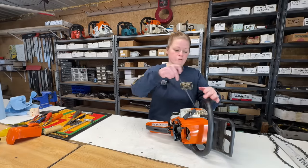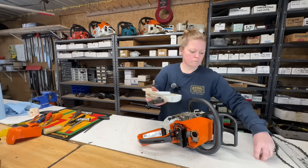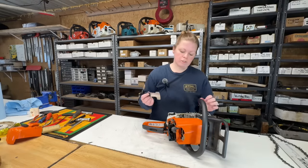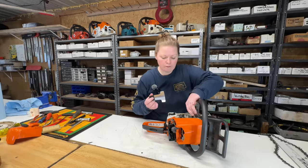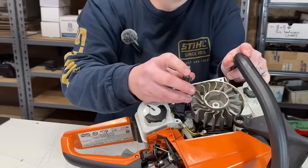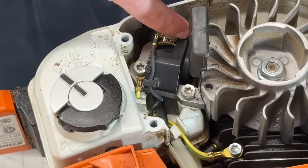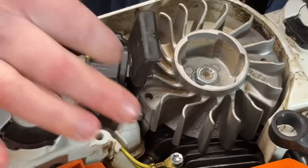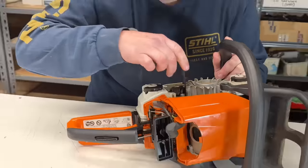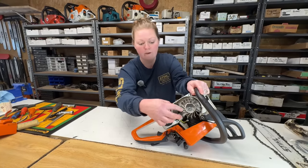T27 — I'll start removing this recoil. I'm going to grab my gap tool and check the gap between my flywheel and my coil. I'll line the magnet up with the coil and put my gap tool right down in there. The coil has a top leg and a bottom leg — you want the tool touching both of them. The top leg feels good — just enough room to get the tool in there. The bottom leg actually feels like there's too much of a gap, and that could be part of our problem.